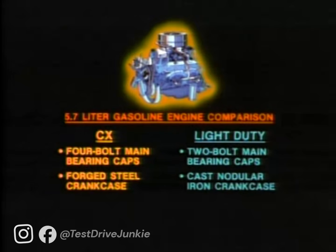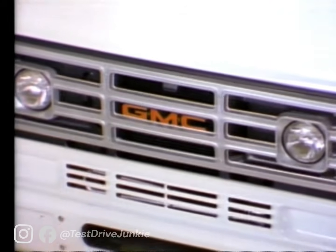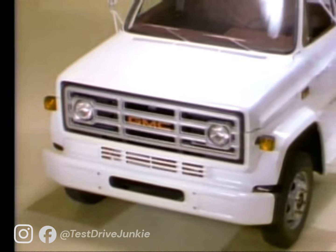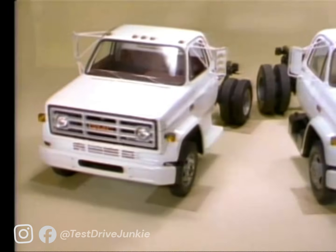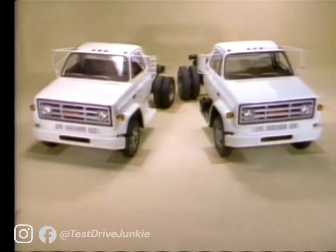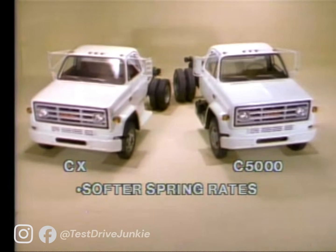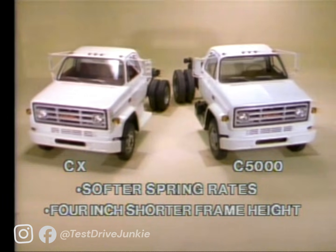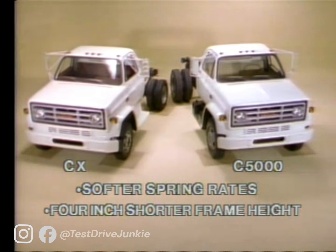A comparison of the CX to the C5000, C6000 series shows that the CX shares the same frame wheelbases and reinforcements of the big mediums, and it shares the same powertrain combinations. But unlike the C5000 and the C6000 series, CX gas models have softer spring rates for an impressive ride. The smaller tires and front axle spacers give it a 4-inch shorter frame height than the C5000. This makes everything above the rail just a little more accessible.